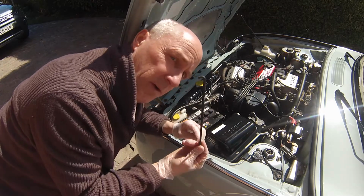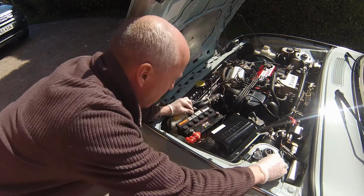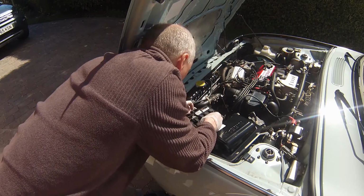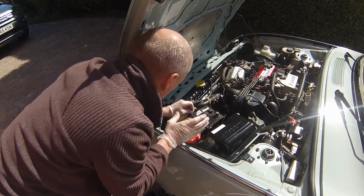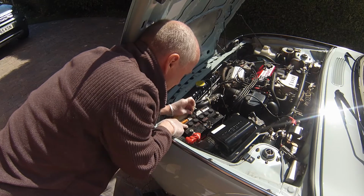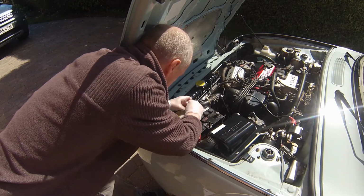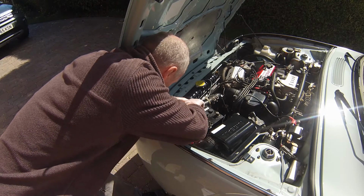So you've got the front little one here. This goes down into that little hole, and then you've got the little plate here. Put the plate on like that. Pull this one over that I talked about before. This is the back one, and then that's it. So we've got that in position now. Make sure the battery sits quite squarely on the plate, and you need to position this between the top up bits here. So obviously don't put it over these bits here, so it's flat to the battery, and then with the nuts, wind them in, keeping hold of the rod as you do the nut up, otherwise the rod will fall back through again.